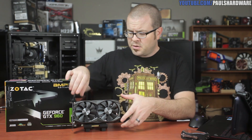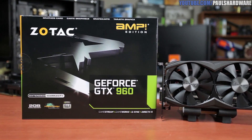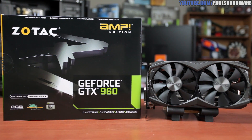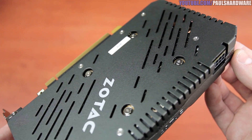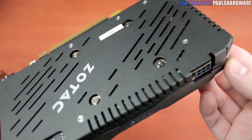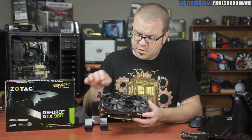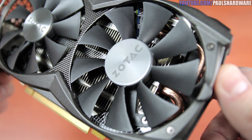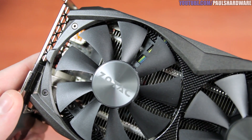Let's start with a closer look at Zotac's GeForce GTX 960. This is the AMP edition, which means it's overclocked from the manufacturer — $210 MSRP — and it has what Zotac is calling exo-armor. That's the back plate on the back as well as the dark gray metal shroud. It's got a wraparound back plate, and the cooler is what Zotac is calling Ice Storm. It has two fans on the front and two copper heat pipes at the middle. They're very long though — they go all the way across the base of the card and then come back around and go all the way back across the top.